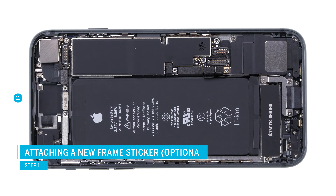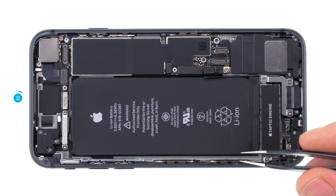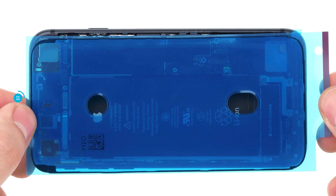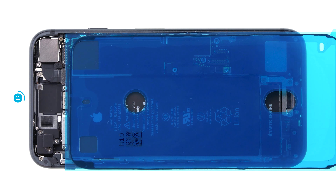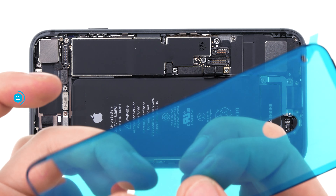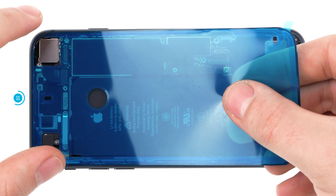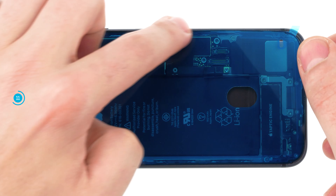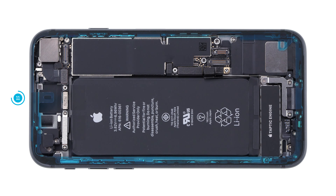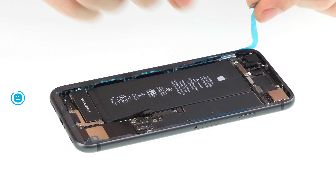To protect the iPhone against dust and splash water, it is recommended to use a new adhesive frame. The procedure shown here for the iPhone 8 is the same for the iPhone 11. First remove all glue residue so the new glue will hold, but remember that the iPhone will no longer be 100% waterproof. Before attaching the frame sticker, make sure it's aligned right — the corners and the holes for the camera show you which way is up or down. Remove the first backing film, put the frame smoothly on one side of the device, press it on slightly, then press the sticker all around, making sure it stays inside the frame. Use a spudger to make the frame sticker hold properly, then remove the second big carrier film. You can remove the last small part of film now or after connecting and testing the display — leaving the film on prevents the display from sticking too early.